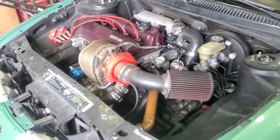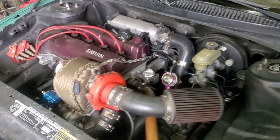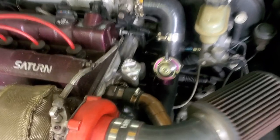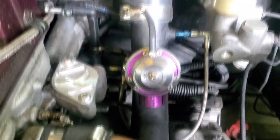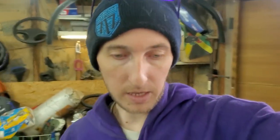I haven't really updated you guys on what's under the hood, but it's practically the same as it has been. I have increased the boost up to about eight and a half, nine pounds, and my extra fuel injector — I got that all nice and tucked away now. That thing has been working flawlessly for over a year now. It keeps the car well within safety range for AFRs, and it's great. I have no complaints. So anyway, that's the car.